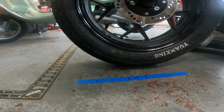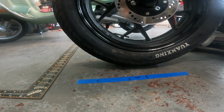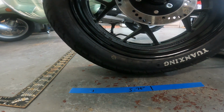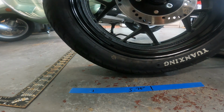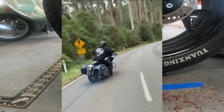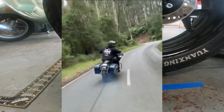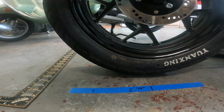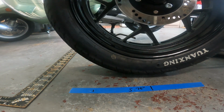If you're used to racing a sport bike and you come out of a corner, if you don't trail brake and get your front end down, you'll have too much trail, so the bike will feel too stable through the turn, and you'll want to push the back end around. So you'll grab a fistful of throttle and slide that back tire around and bring the bike back into turn. When you get on these weak ass bikes like this that don't have any horsepower, you can't slide that back wheel. You're not going to grab a bunch of throttle and do that.